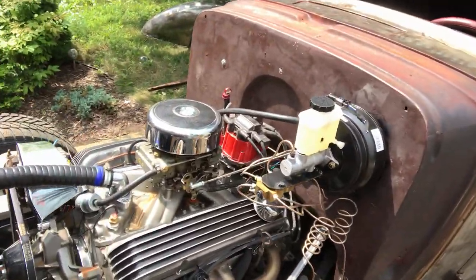Oh, I forgot to try the steering. I better go back and do it. Nah. No, I really need to wait and make sure there's no fuel filling up the area down there. I'm pretty happy for now. Brakes definitely work. I think I might just either need to bleed it more or I need a return spring in the brake just so that it doesn't feel so soft. But they definitely work, obviously. Happy days, and the sun's come out. Awesome.